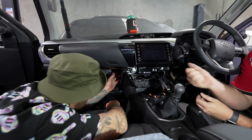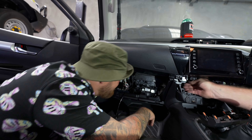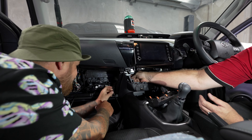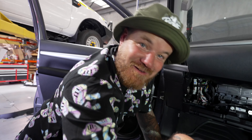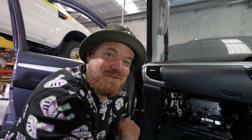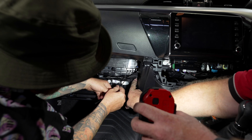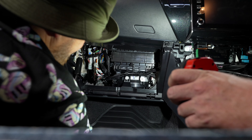We're going to follow the wiring through here. Make sure you've pulled the wiring all the way through up to where the convoluted tubing is — it'll pull and stop. Pull it through to about that point. You'll need two zip ties inside the cabin: one up higher and one back down over here, which keeps the wire away from the glove box once it's back in place. Cut your tails — leave a little bit on to get the next guy.